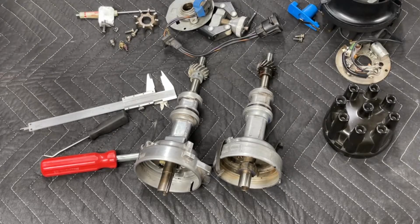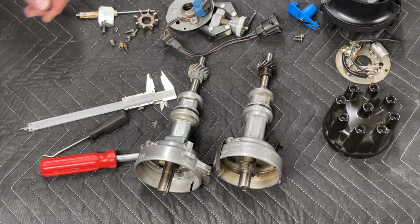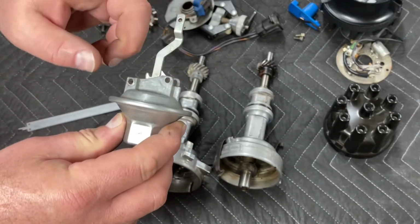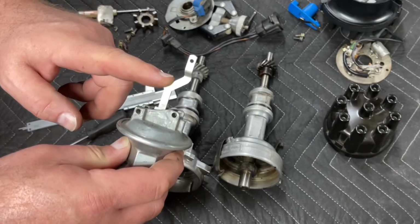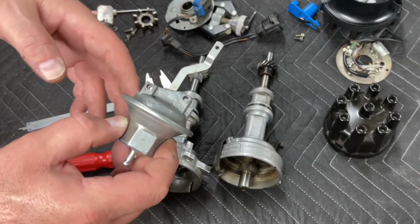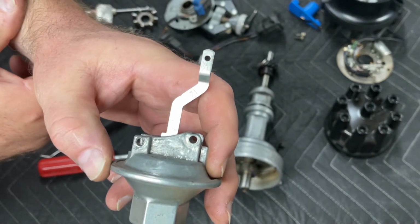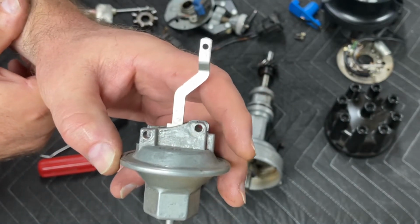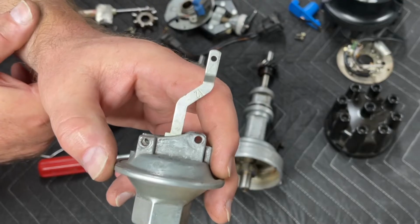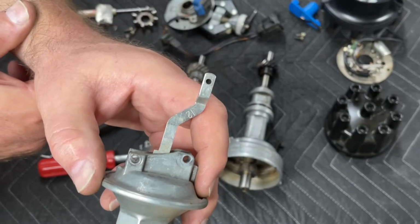So when I go into the throttle, I'm going to be on manifold vacuum on my vacuum advance, and that's going to result in this losing its vacuum signal, and with the loss of vacuum, this advance will go away. So basically what I'm doing is I'm utilizing this old distributor technology to mimic modern fuel injection. This is an adjustable vacuum advance, and that means I can adjust how much advance I get from how much vacuum. I can have this thing advancing all the way down to about 3 inches of vacuum and all the way up to whatever the peak vacuum is for the engine.